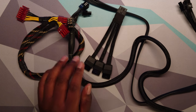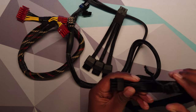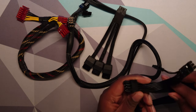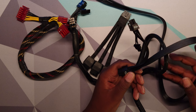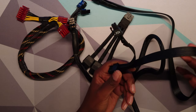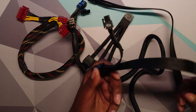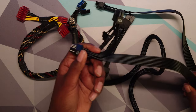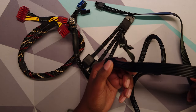To come back to the big issue: pigtail cables are fine. The worst part about these cables is the connector, and the connector can handle a lot more power than you think. As long as you buy from a good power supply manufacturer, the cable is going to be thick enough, and the build quality of the power supply is going to matter a lot more. If you have multiple of these cables — like four or five from a 1000-watt supply — use multiple of them. But don't feel bad just because you're using pigtail connectors.